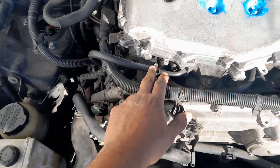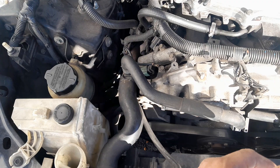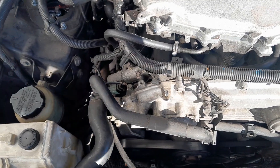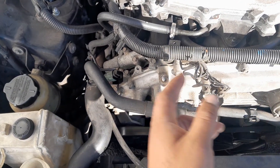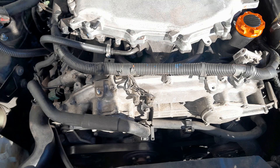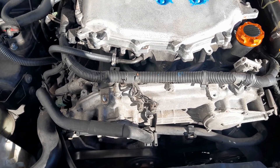Normally when you install this, you have to connect it to the PCV valve. The PCV valve goes to the can, and all the oil is supposed to go to the intake to get burned. Instead, the oil gets stuck in the can, and clean air goes to your intake.